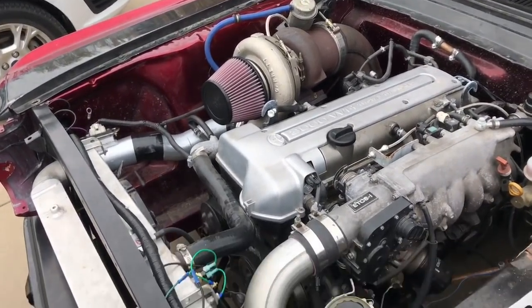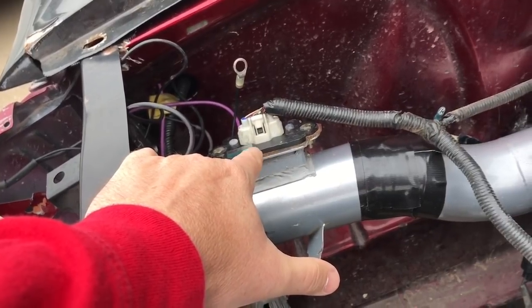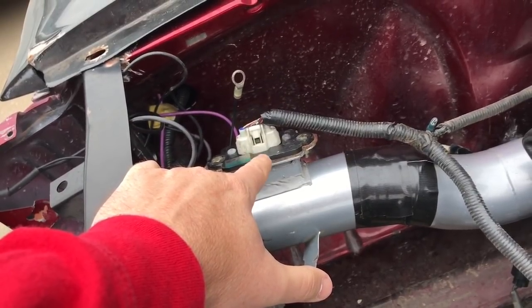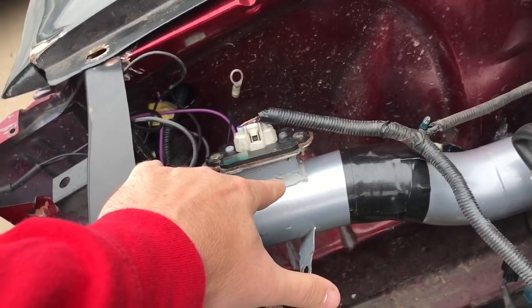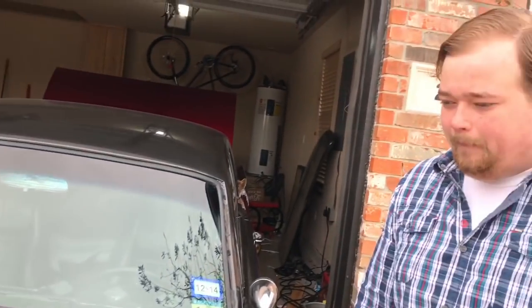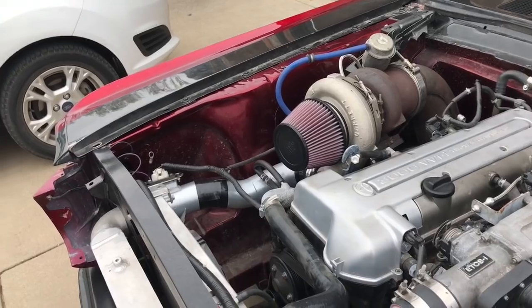So we're out here talking — I was kind of making fun of some of Matt's welds. And then he was quick to remind me about this nice little job I did here. This was one of the first things we did when we were getting this thing, trying to fit it in here — make a flange for the mass air flow sensor. I was not confident that my weld was very good, and it wasn't very good. So I siliconed all the way around that weld. That is 32 PSI silicone as well. He had to go ahead and point that out. Don't hate. And don't forget about the clampless boots — they're specially designed to hold 32 PSI without boots or clamps.